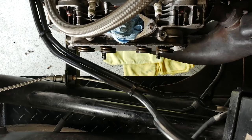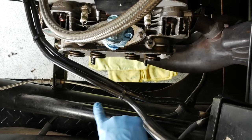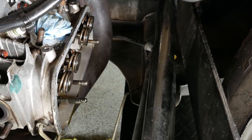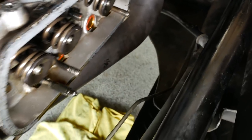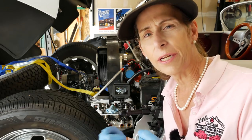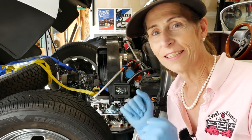Place your bets now — that's how far the head is from this diagonal member right here, which is the thing we need to clear. I give it a 50-50 chance; when I measured it was within an eighth of an inch, which could go either way. I have to get this entire head over these studs. We've got all the bolts off and all the washers out — the head is ready to move. These are usually a little hard to get going, but I'm more worried about the clearance. Let's give it a try.